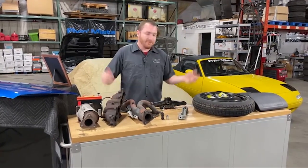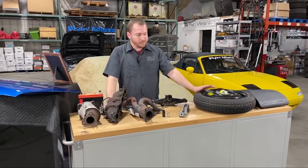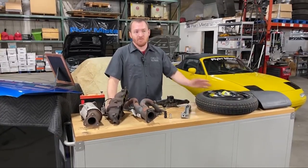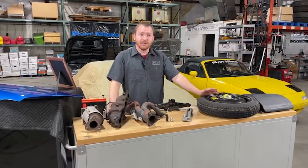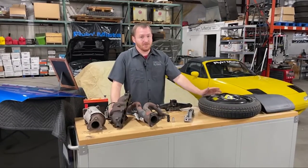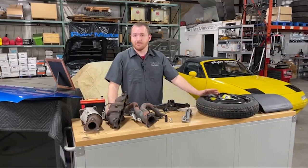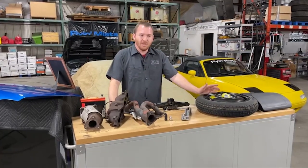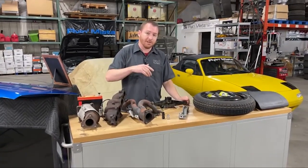So, as I mentioned earlier, my name is Mike. Thanks again for joining us. Let's get right into it. Weight savings — why is it a thing? Why are people concerned about saving weight or trying to shave weight on their Miata? Well, if you are class restricted by a certain racing class that you're in, or if you're just trying to make up for a bit of power-to-weight ratio, then it's always a good thing to lose a bit of weight, because that means your car has to work less to get up to the same speed or to produce the same amount of acceleration. It's kind of like adding free horsepower by adding lightness — removing heavy stuff or replacing heavier stuff with lighter stuff.